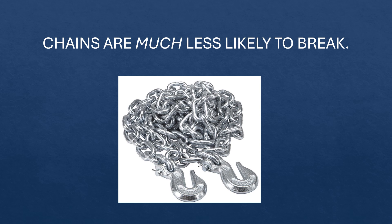Actually, no. Normally your car has power going from the engine through the transmission to a final set of gears called the final drive. When the car is being towed on all four wheels on the ground, the engine is not running and normally you'd put it in neutral. The process mechanically is running in reverse — the drive wheels are being turned and the turning force goes backwards through the system, through all these parts, up to the transmission, turning it backwards. This can do damage to the transmission because it's not intended to operate that way.